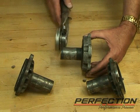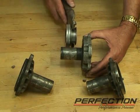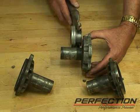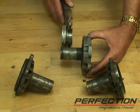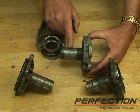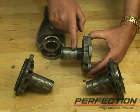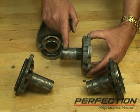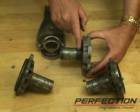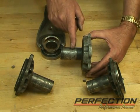So as the bearing moves in an arc, it's always pressing against the side of this guide tube, kind of side loading it as it wears. The guide tube has to take that arc motion in the bearing and straighten it out, move it in a straight line. So there seems to be wear right here and right here on this particular one. We've got a ridge right here. We've got a kind of a low spot or a valley here and here. You could measure the original size back here and compare it out here. You could actually see how much it wore.